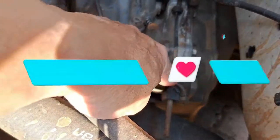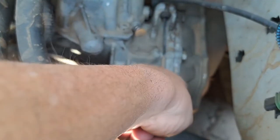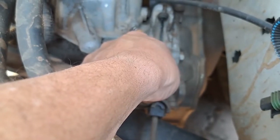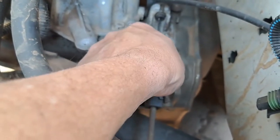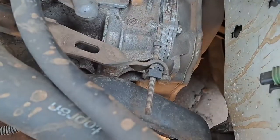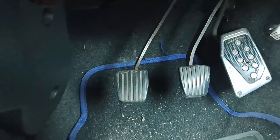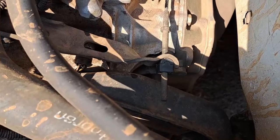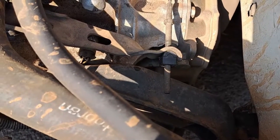What I'm going to do is adjust this back more to bring the cable forward. I think that's where it's supposed to touch - or actually to the back. Yeah, it's supposed to go back. But let me see what I can do. Okay, now I know the clutch has to be replaced. The clutch plate, the whole kit is stuffed. I can release my foot totally and accelerate, but the car's not going anywhere. By the time you watch this video I would have gotten some money and been able to get the clutch kit.